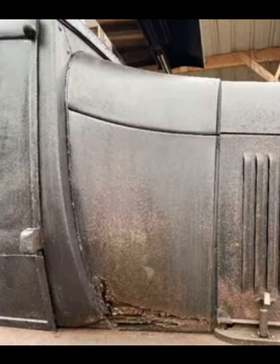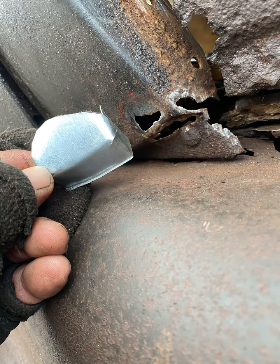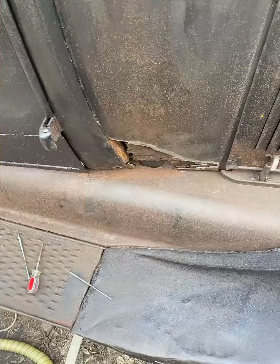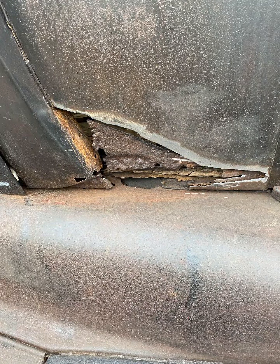This mess is next — a lot of that has to be cleaned out from the inside of the cab. It's a little cumbersome with hard-to-reach spots, but I want to get everything rust protected and fixed. First we have that little boogeyman face to get rid of. This little patch fits in there perfect from the inside of the cab, still retaining as much of the original metal as I can outside. I got it all cleaned up — a lot of it from the inside using literally dental picks, anything I could get down in there, with a really powerful vacuum drawing out all the debris.